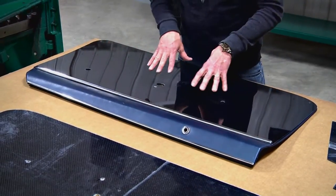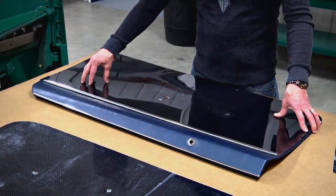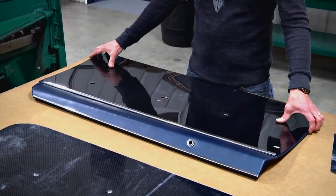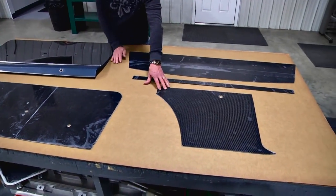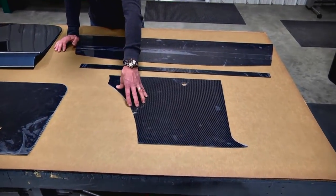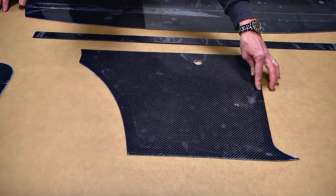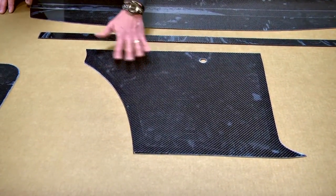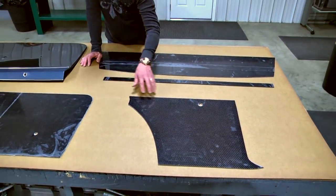Once you do that, the stock inner closer will fit back in the hole, the opener will fit, the window crank will fit, and all the little plastic retainers will fit back on there — and then this piece is done. The quarter pieces are exactly the same way. They have the same strip on them and go in exactly like the door panels. They don't have any screws in the bottom though; the back seat and this trim piece on the door edge hold it in, along with the window crank and the stainless strip. So there are no screws in that at all, and this will complete your inner door panel and your quarter.